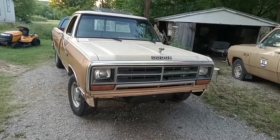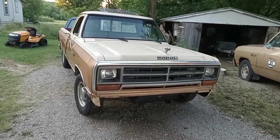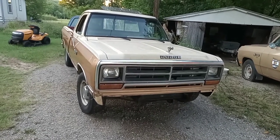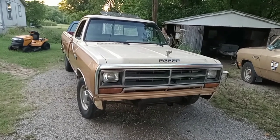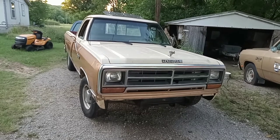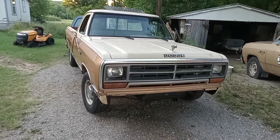I went out later that night and tried to start it. Nothing. But luckily, I had some pickups available, you know, and distributors. So I just changed the whole distributor, and she's good to go now. Like I say, I put quite a few miles on it, and so far, so good. So I couldn't be happier.